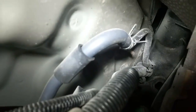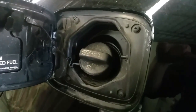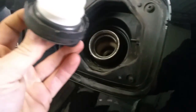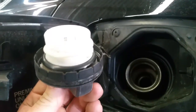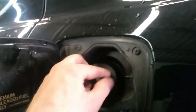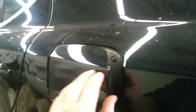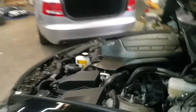Next I checked my fuel cap door. I opened it and checked to make sure the gasket doesn't have any cracks in it, because if it does it's also going to cause a code like that to come up. That was fine as well.